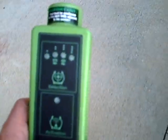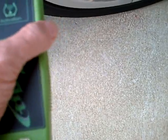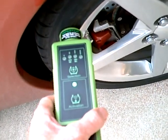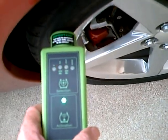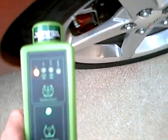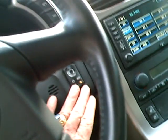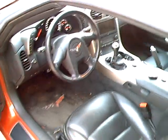And the left rear, the last tire, should get a double horn honk. There you go — a little delayed there. We had the double horn honk, and then we got our flashes on the tool. We turn off the ignition, and we have completed the registration of the tire sensors with the tire pressure monitor system in the car.